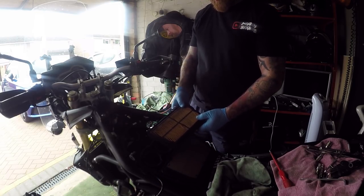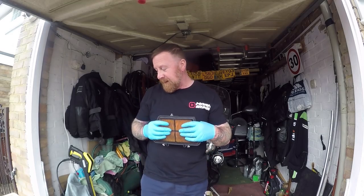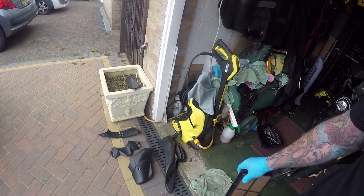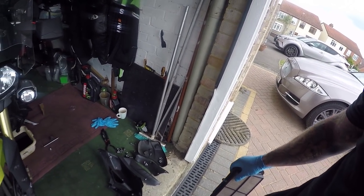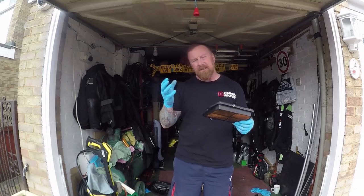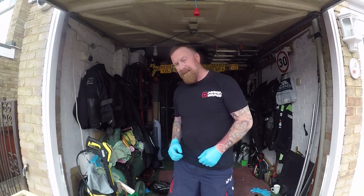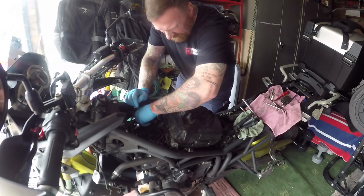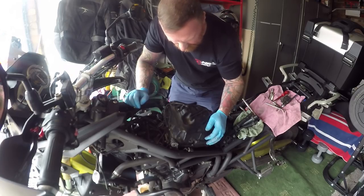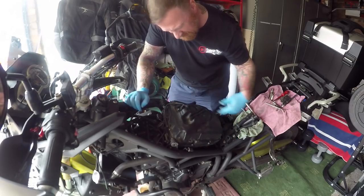Let's start getting it all back together again — which will take some time. All in, Triumph didn't want you to do this yourself. My only top tip is: as you take panels off, keep the bolts with the items you take off, and the same again left and right. Don't put them in a tub — because, while I know they're all the same size, some wore from the outside and some are grainy from the inside. Just keep the panels with the originals. Honestly — were they in the garage at Triumph going 'We've got 30,000 bolts left over, what do we do with them? Let's use them all on one bike!' My god that's marvellous.